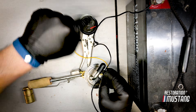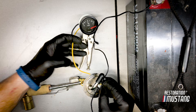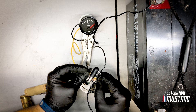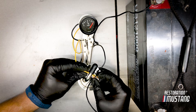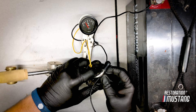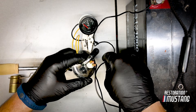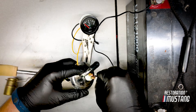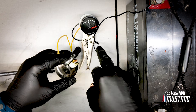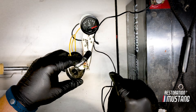Once this tested correctly, I knew I had an issue between the wiring of the gauge and the sending unit. Let's reconnect that sending unit wire back again. Let's go to empty. Now let's pull the ground — see what happens when the ground is killed. Either one of these two wires could have been bad; it goes right back to the same position. That's how you know: if your gauge is reading full-on-full, you've got an issue with your wiring between your sending unit and your gauge.